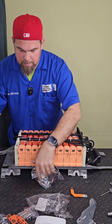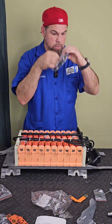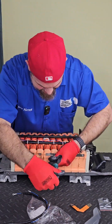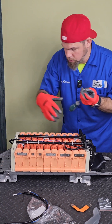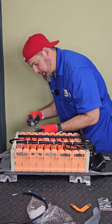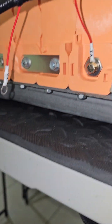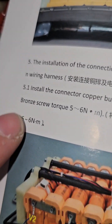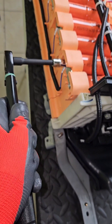In the meantime I can assemble all the bus bars to connect the battery in series, and also connect the voltage monitor. It's now an active high voltage battery — although the circuit is open between these two, we still already have high voltage here, so we've got to be very careful. V1 is the main negative; V3 and the others are the positives, so they're going to go right here on each positive. The owner's manual calls for 5 to 6 newton-meters torque on these bolts — let's tighten them up. They are all fully torqued.